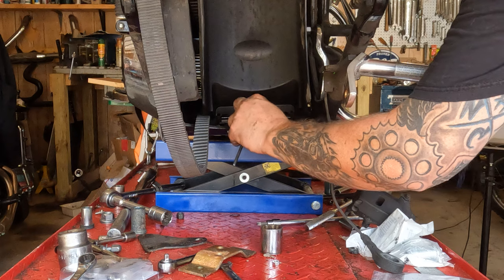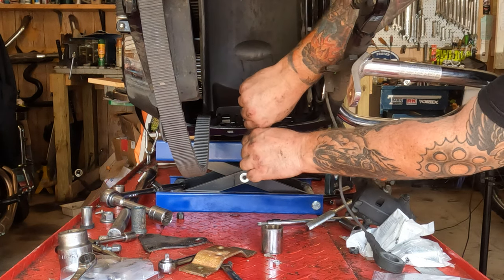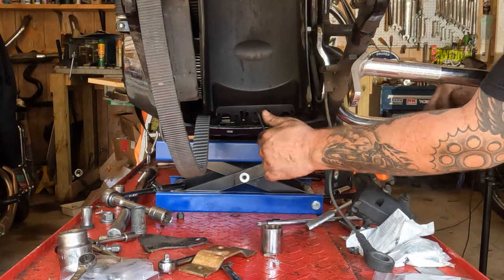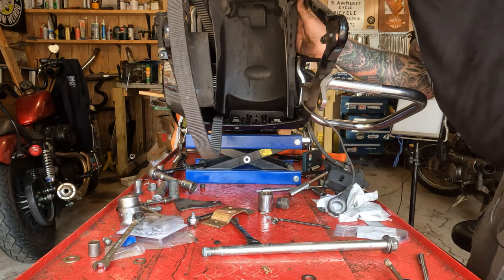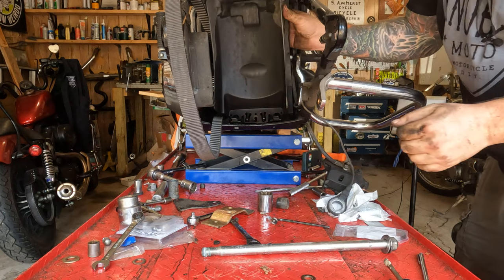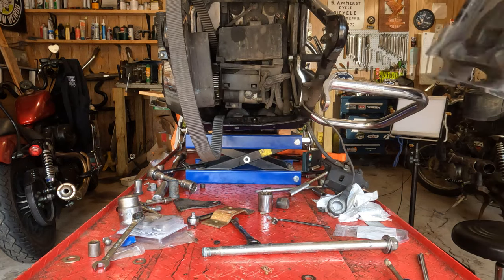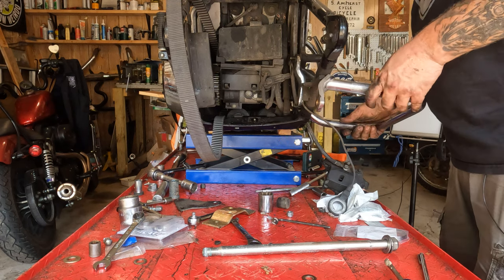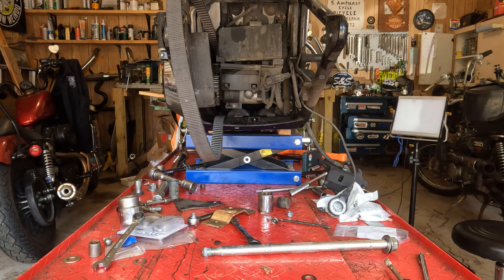At the bottom of that mud flap, there's a quarter-inch screw. It takes a 3/16 Allen wrench. Take that on out. Oh yes, top of this pops off like so. That should just pop right up off and out of there. You can take that nut off right there. You can take the rest of your crash bar or saddlebag protector bar off. Set that in a safe location.